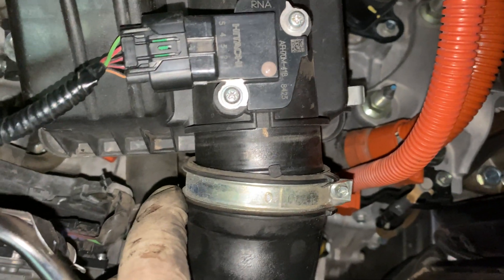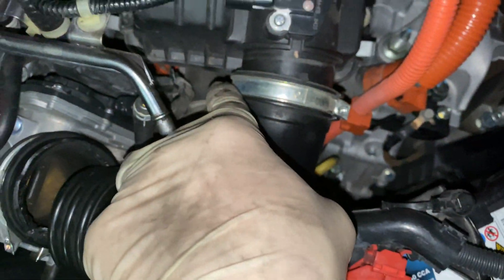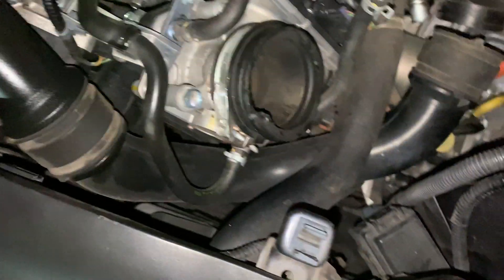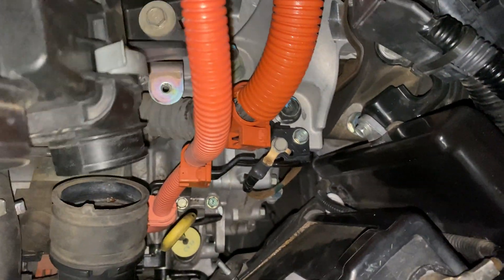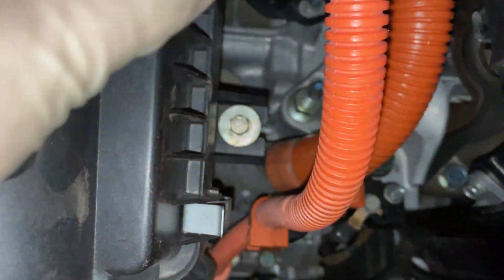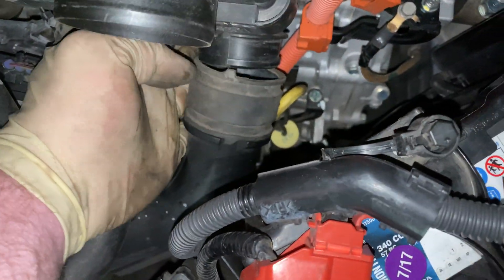To get this one off, you're going to have to unscrew the intake tube from the air filter. This one's cracked and needs to be replaced — I covered that in another video. Take that off, unplug the mass airflow sensor. There's one base screw right there, another one right there. Pull it out, pull the air box out, and then you have this duct tube — take that off, size it out a little, and set it on the floor loosely.